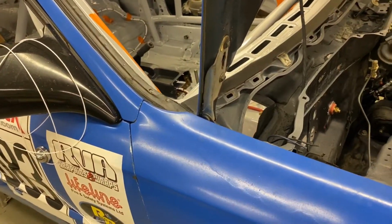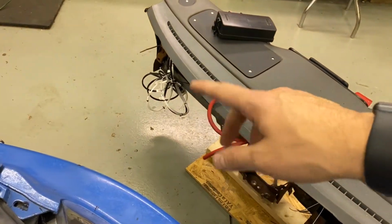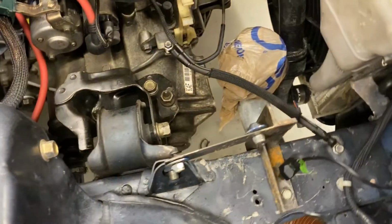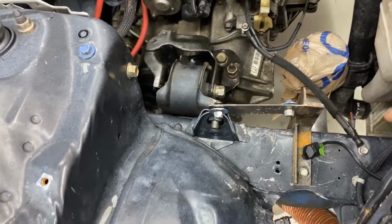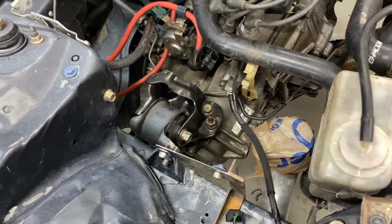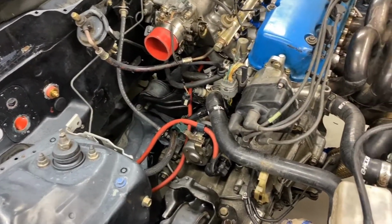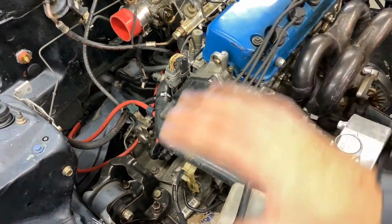So anyway, my next steps for this car are the headlight outputs, boost control solenoid, fan, corner lights, and the transponder. The transponder is what tells the track when we pass the finish line. We keep it right there because it's low to the ground, so it's actually mounted to the engine. I'm not going to put it on the engine harness. It's on the body harness, even though it's on the engine. So that's one thing you want to do: keep your body harness and your engine harness separate from each other as much as possible. Anything that doesn't go on the engine stays off the engine harness.